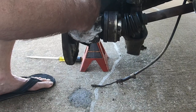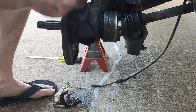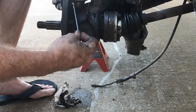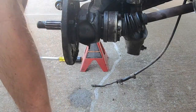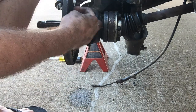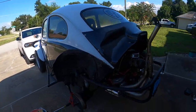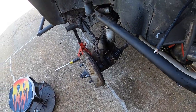That just tightened in easier than ever — I've never had one go that easy. Once this gets snugged up, we'll go ahead and grab a line wrench and snug up the line properly so we don't strip anything out. That's pretty much it for the back here except for bleeding the wheel cylinder. So again, you use your line wrench — that's the difference in a line wrench: it wraps around more, so you get a better contact patch and get it tightened up without rounding off that little hex part. Well guys, that could have been a lot worse. Luckily we're pretty much back together. Got everything torqued, got a cotter pin in — it's a little small, but it's all right. Rear brakes are adjusted, bled out, all that squared away.